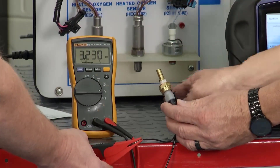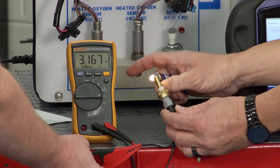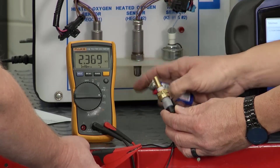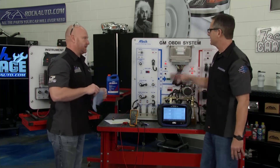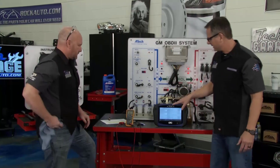Check this out — I'm going to go ahead and torch it. It's just like when you drive. Let's get this thing nice and hot. See that? Look at what's happening to that resistance — we're leaning out the fuel mixture. It's dropping. And that's what you said earlier, Brian — you mentioned it's actually messing with the fuel mixture. It is.